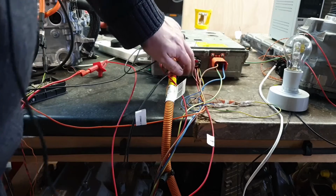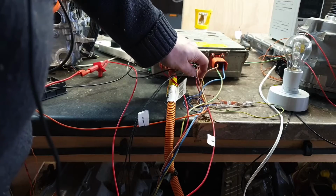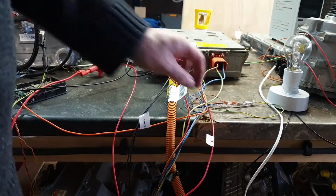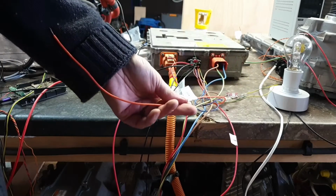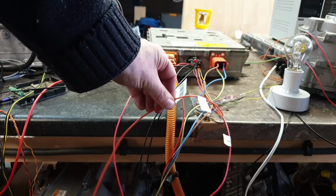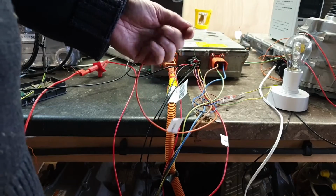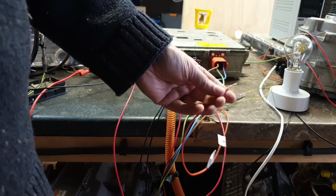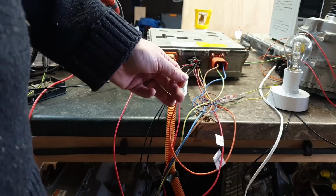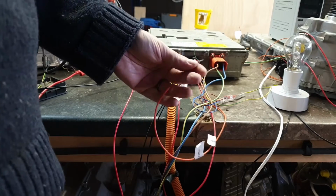Moving along then, we've our second charge port temperature sensor. And second last from the right on the bottom row, we've our next signal that I don't know about. Best name I can find in the diagrams is called Connect Confirm. Now this one I suspect is quite important. It does not output anything regardless of what the CAN logs are doing. No matter how I stimulate this, and I have to be kind of safe and use resistors,